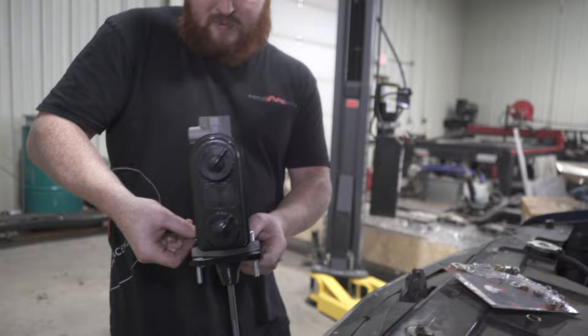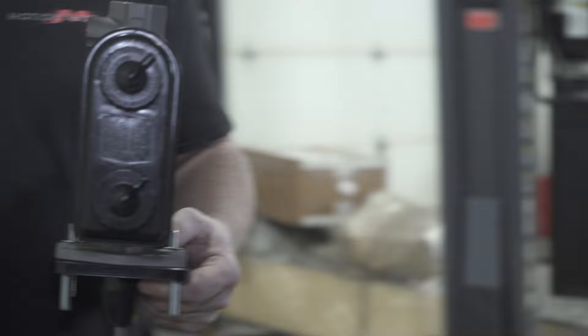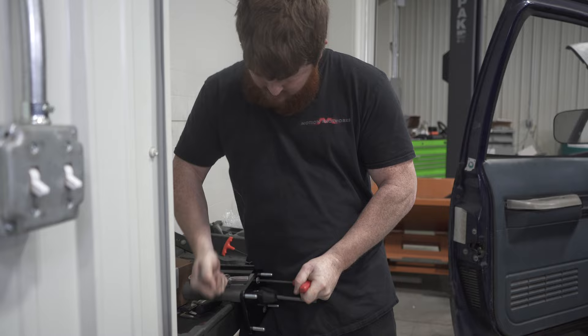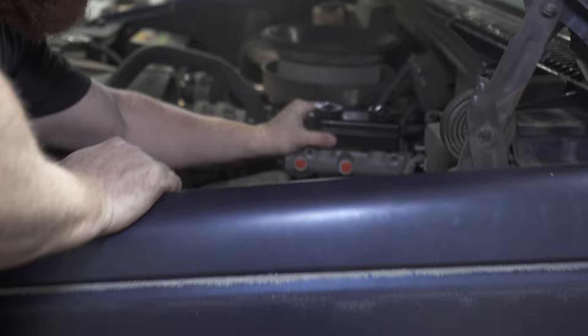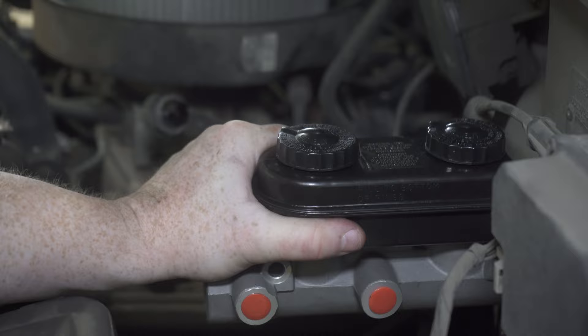Back at the front of the truck — we've got our little stainless washers, we have six of them: two for out here and two for inside the truck. Installing the nuts now so I can get to the backside and hold the bolt when I snug it up. Now we've got our master cylinder assembly ready to go on the truck. I'm going to go inside with my four washers and four lock nuts — and this is where it will help to have a buddy around. Stick this right into your holes, and this is where your buddy stays while you go inside and tighten the nuts up, because otherwise you're just going to drop it out.